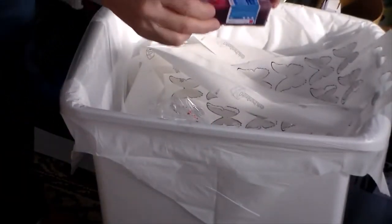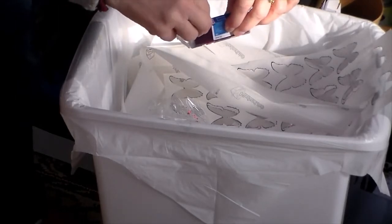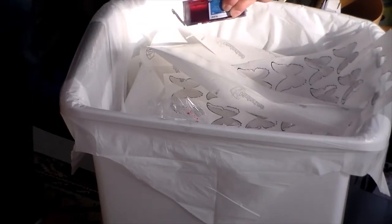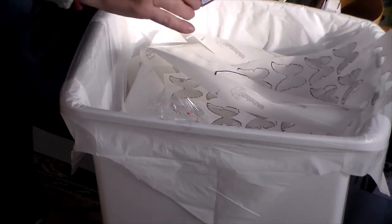So I'm going to do that over the garbage can. Let me see if you guys can see it dripping. I'm going to pull the stopper out — that will release the vacuum — and you want to wait until it drips, and you'll see the level of the ink in the reservoir start to drop. There it goes, and then put the stopper back in. Once you know that the ink is flowing through the cartridge and going into the printer, you can put it back in the machine, and that might actually solve the problem.